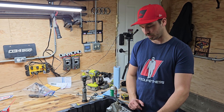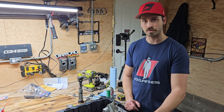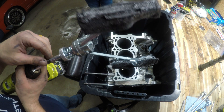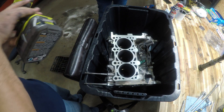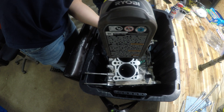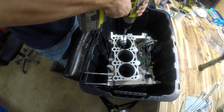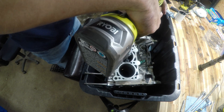We'll spin them around, clean bank 1 out — cylinders 1, 2, and 3 — and probably end up having to re-hone those ones as well. Going for cylinders 1, 2, 3, and 4 now. Just bringing it in front of the camera to clean out the bores and put a little bit of paste on each of the felts. Going to do them again — run it for a minute and a half. Added some more paste on the felt and WD-40. Let's go.